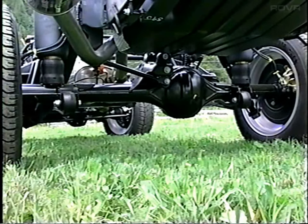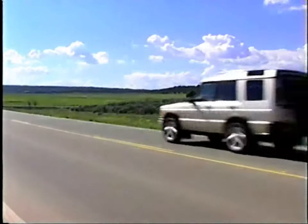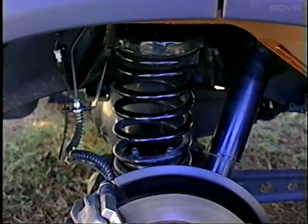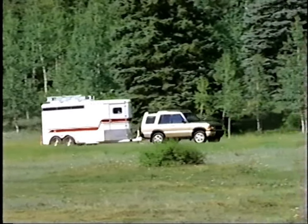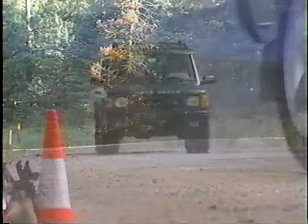The Series 2 rear axle has similar improvements. New radius arms are designed to improve the level of anti-jacking, which is the amount the rear end lifts during braking. This improves braking stability and comfort. The rear coil springs are multi-rate, a design that provides a comfortable ride over a wide range of loads. Like the front axles, the rear axles are fitted with tuned isolators between the spring and chassis to improve NVH.